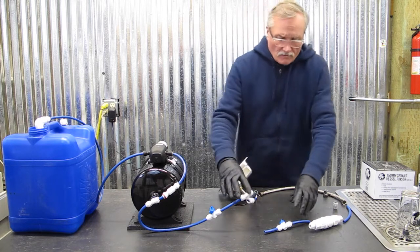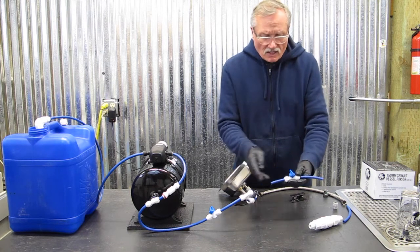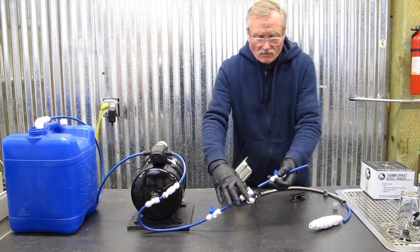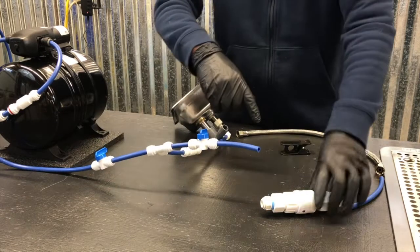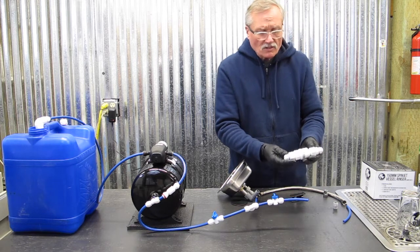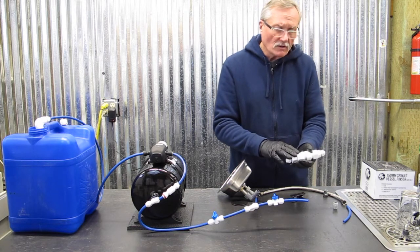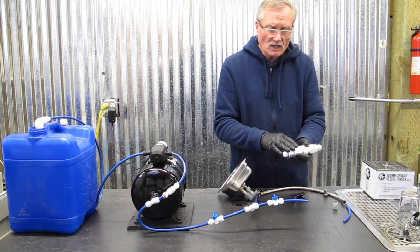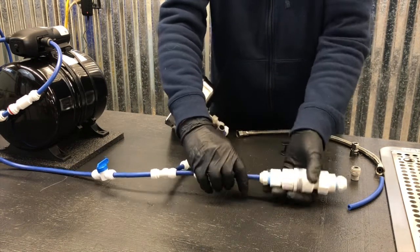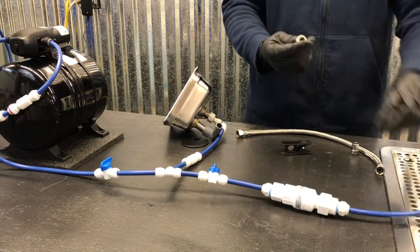We've reconfigured a couple of parts but mostly just in sections of tubing. A section of tubing runs in the direction of your espresso machine, with another 3/8 inch ball valve in the line on the way to the pressure regulator. This is a 30 PSI inline pressure regulator that is also a check valve and an inline strainer. This is going to allow the low-flow pre-infusion, if your machine is capable of that, to operate well.